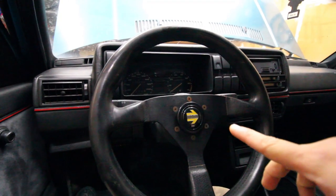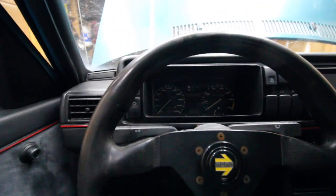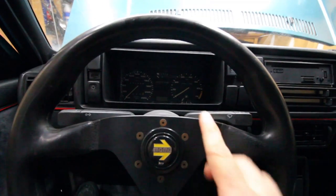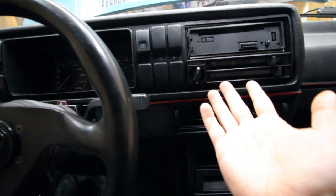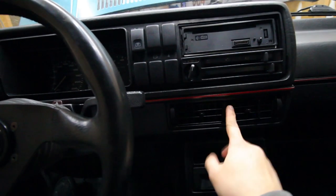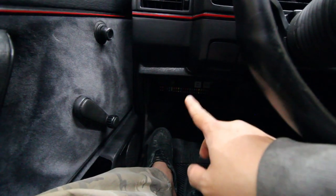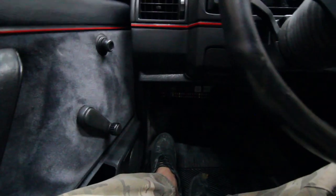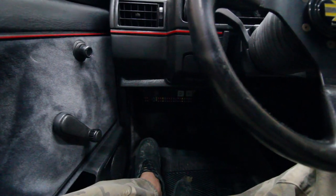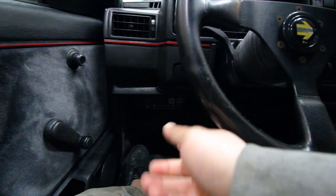I thought we were in the clear until I tried to start it up yesterday and two things bothered me. Number one, the car kept climbing past operating temps and the coolant fan wouldn't kick on. I tried to turn on the heat and noticed there was no fan coming out of the vents. So right away I popped the fuse panel open and found that the blower motor fuse was indeed split, so I've replaced that.